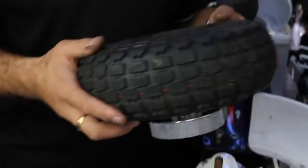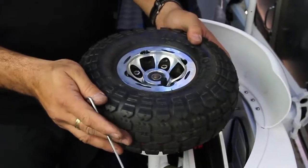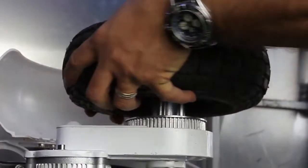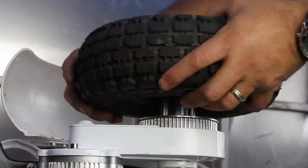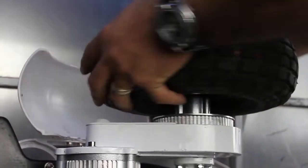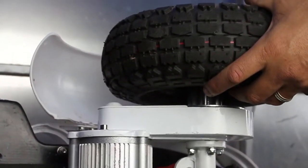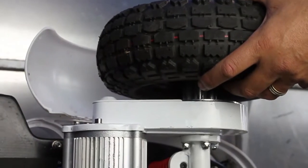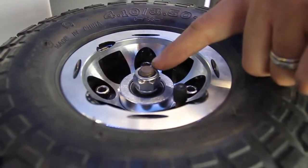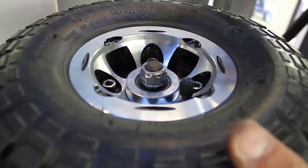You are trying to fit the belt over the drive cog, and the easiest way is to simply locate the axle pin. You may need to just line up the inside, and you will see the axle starting to show through the wheel. The trick is to place the wheel over the belt and apply a little bit of forward and reverse pressure — you are trying to locate the teeth inside that belt. When you feel them, you will feel them click, and you should hear that noise which indicates the wheel is seated inside the belt on the axle in the correct position. Final tightening should be done, again ensuring the nut is not over-tightened pushing down against the bearing. They're nylock nuts and all they require is just a little bit to catch on — we are not about over-tightening anything.